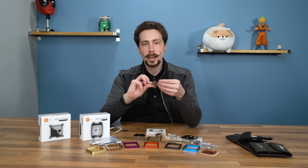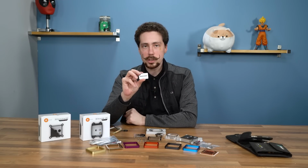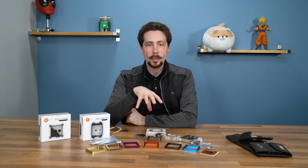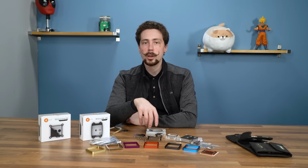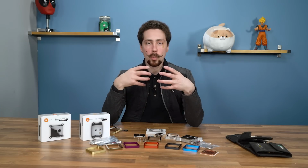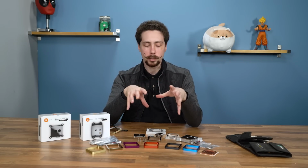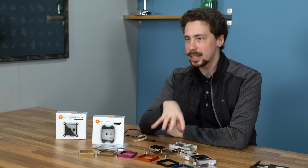It's also worth noting that you get a few different types of these jet plates when you have one of these blocks. So this is the standard one that comes in with the AM4 bracket. But if your CPU maybe has a particularly concave shape to it, you can add a thicker one, which will allow it to have more of a convex shape to be able to match that CPU as well. So these blocks are designed to be taken apart and played with.